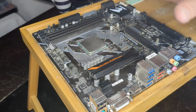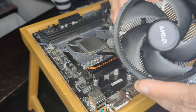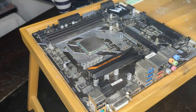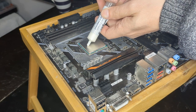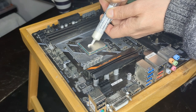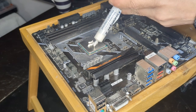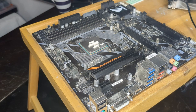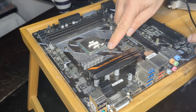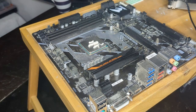I took it outside and gave it a clean. That's not perfect but definitely a lot better than it was. I also took the cooler outside, gave it a clean — same thing, not exactly perfect but much better than it was. That poor CPU must have been cooking — it was so dry under there. So I'll just reapply some thermal paste. I think I'm running out of this stuff. This isn't the best thermal paste either, but it is cheap and it's a big tube because I kept running out of thermal paste. The worst thing is not being able to complete a build because you don't have thermal paste. I'll reseat the CPU, but this one seems pretty well in there.